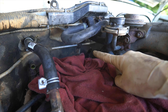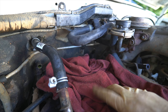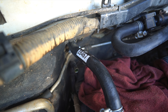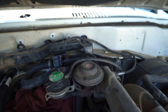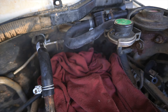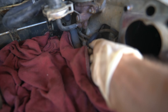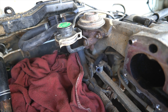Here's our bypass all complete. We now have empty lines running to the rear heater — you can choose to remove those, they're tough to get to, so I'm going to flush them and remove the heater under the seat. This hose is just a length of hose; I used Gates part number 28467 which comes with a 90-degree elbow, and I used that elbow right here. We reused our spring clamps. This OEM hose goes right into the firewall and connects to the heater, and another coolant hose runs down through the intake manifold and plugs into the block.